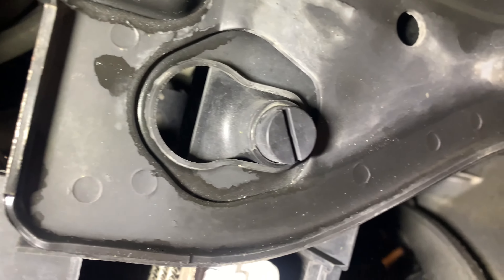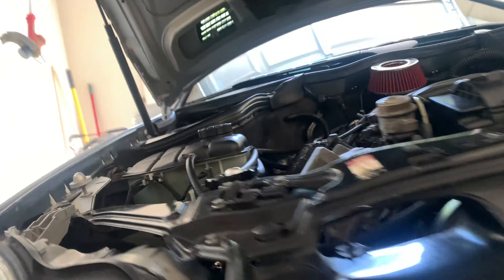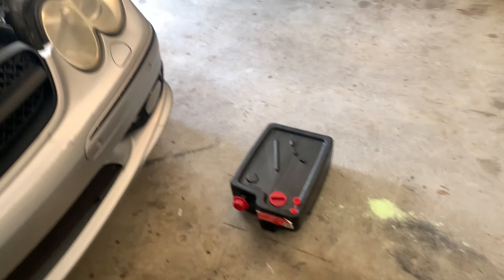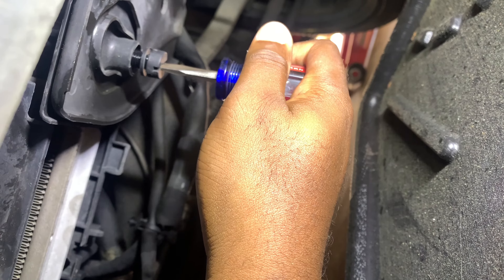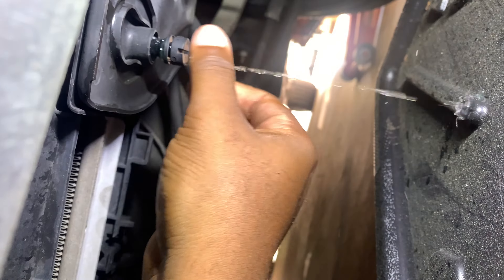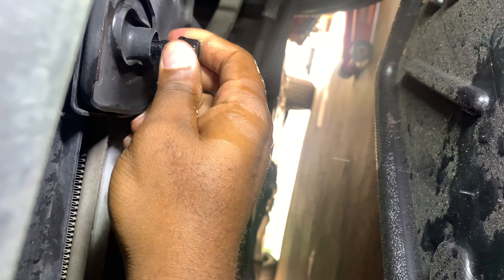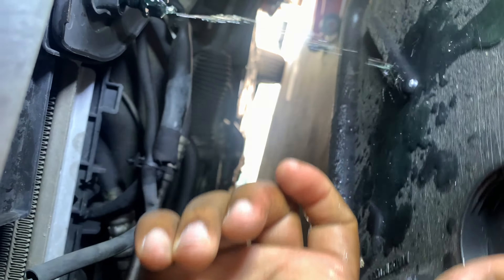Let me show you down here at the radiator. There's a plug that looks like it takes a flathead screwdriver — pretty much just unscrew it. Coming up to the engine bay, once I have that open, I'll open the reservoir cap to release pressure and we'll get coolant dripping out. The drain comes out all the way — you can hear that? That's coolant about to rush out. I'm not getting that much out until it's completely open — it looks like the plug stays in, so opening the top makes it come out like crazy.